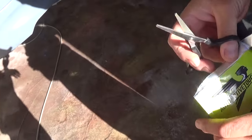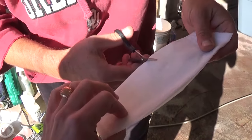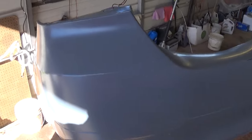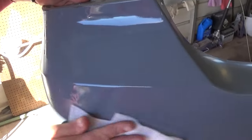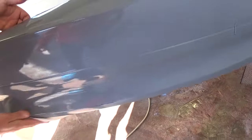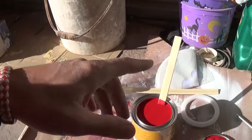We're going to open it now. What we usually do is cut one of those wipes in two, because one is a little too much for just one body part. With a whole napkin you can do two bumpers, no problem. You can see how it gets wet — that's perfect, it cleans super nice and it dries fast as well. By the time you're done it will be almost dry, so just give it about two to five minutes before we start painting. Make sure we get all the edges and everything — that way the paint will stick to it really good.